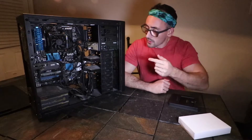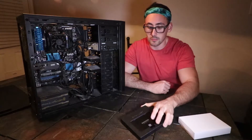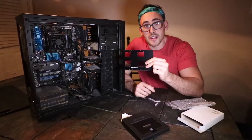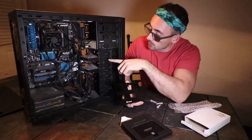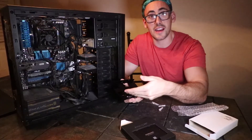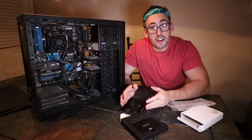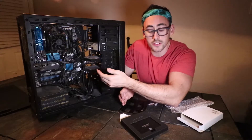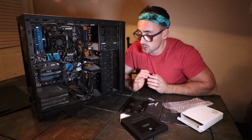The next thing you've got to do is find one of your drive slots and take your new hard drive. It's obviously smaller than the big ones, which is why we ordered this small adapter plate. What the adapter plate does is make the small hard drive fit and still mount to one of the big 3.5-inch slots — the SSD is a 2.5-inch. It comes with screws. Then you hook up a SATA cable into your motherboard and take your power cable from the power supply and plug that in.